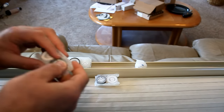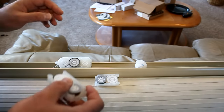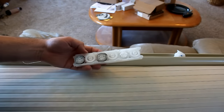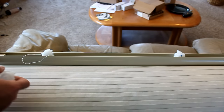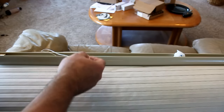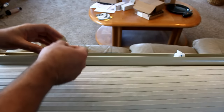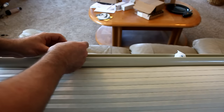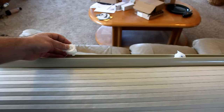I'm not sure how to fix that one — maybe I'll try to cut it down with a Dremel or something. Maybe we'll see if it'll function off of just two springs. That certainly seems like the easiest thing. I fixed two of them and haven't messed with the broken one yet because it's more than I want to get into today. The next thing is we're going to have to wind them up, because we want spring tension when it's all the way down, and no spring tension when it's all the way up. We need to wind them and get them roughly equal so they have about the same amount on each one — I'll just wind them by hand.